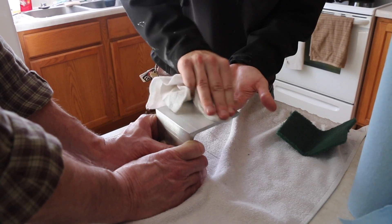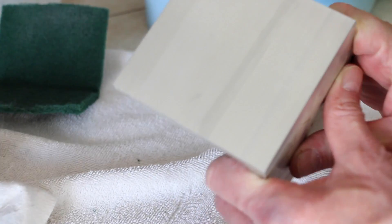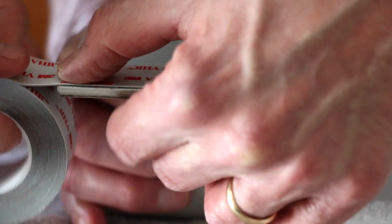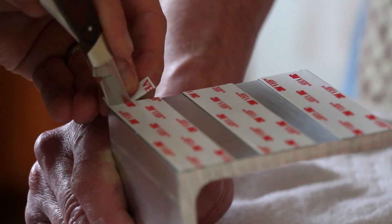We've been on the road for five months now and it has been rock solid. I'm so glad we don't have extra holes in the roof. To clean the surface first, you just need standard rubbing alcohol and a clean towel, cleaning in the same direction until you can't see any more dirt. Then you take a green scotch pad and scuff up the surface, all in the same direction. After scratching it nice and shiny, take another clean towel with alcohol and get it cleaned off. As soon as the alcohol evaporates, you're ready to put the tape onto the surface — just apply it and roll it so it fully cures. After attaching tape to all six brackets, we let it sit and cure so the tape would fully cure to that one surface first.